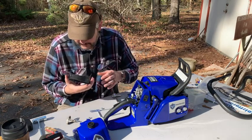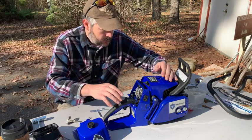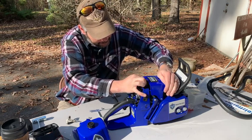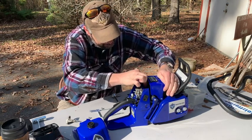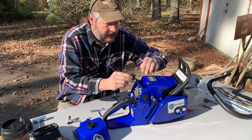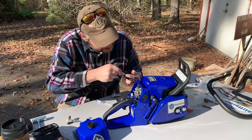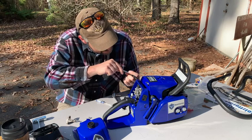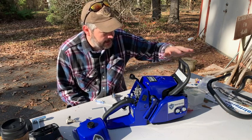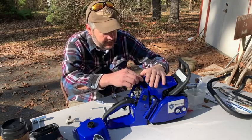So, let's see, that slides off. There's a little groove that slides in on the top, but we will just pull this plug here. I say we will. The spring is not wanting to come off. It's kind of got twisted down in there. See if I can get that. Hopefully. Anyway, I'll go through and make sure the head is tight, the muffler bolts and inside there, and take those off. Make sure everything's got thread locker on it, or just tighten it down.